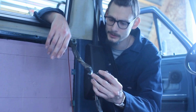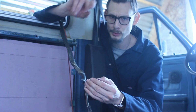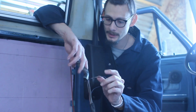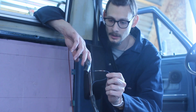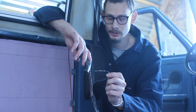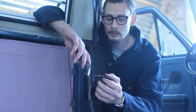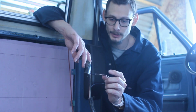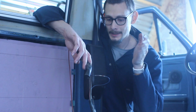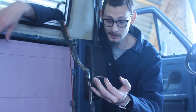Now this came out when we were stripping the transmission out, and the drive lines out, and we just pruned back these wires thinking no big deal, we won't need them. But where this break was, in between these two points, there was a backup light switch that was actuated by the manual transmission shifter. So what we'll do is tap into this line right here and trigger it optionally based on forward reverse settings in the computer, and then when we need reverse we'll energize this circuit and then we'll have reverse lights. And honestly that's it, everything works.